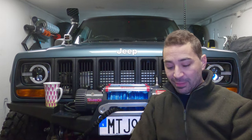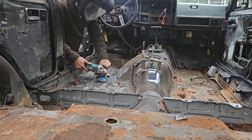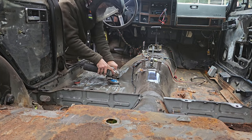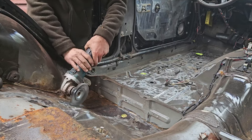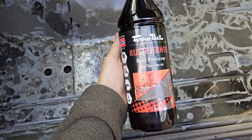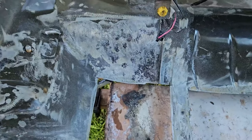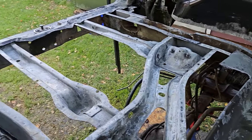There's one tool you're going to become very familiar with if you own a vehicle like this - a grinder and wire wheels. One product I would absolutely shy away from is rust converter - the tannic acid stuff, the white spray that goes black and is supposed to convert rust so you can paint over it. Those products are rubbish, don't use them. Just use a wire wheel, get rid of as much rust as you can, then use a rust removal spray that actually removes rust out of the pitting. Once you've done that, use a high-corrosion primer or two-part epoxy primer over the top and it's going to be good for many, many years - probably your lifetime.